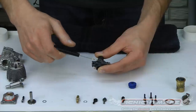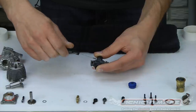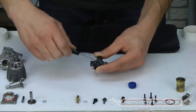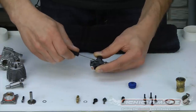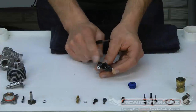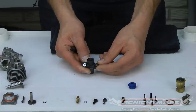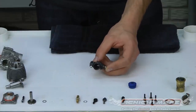At this point it's not crucial to get it set to the right gap, but if you know what that is, you might as well do it. It's about a half millimeter gap and I'll show you that in just a sec. Screw that in all the way — this will lock in the barrel so it can't fall out. Looking right down the barrel carb, push it in until it stops and you want to see just a tiny half millimeter gap. That looks good.